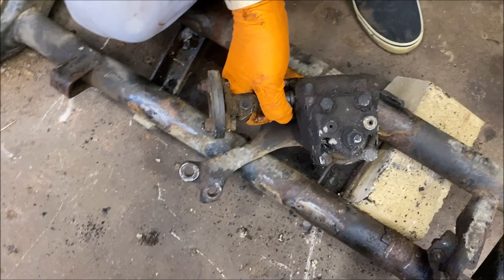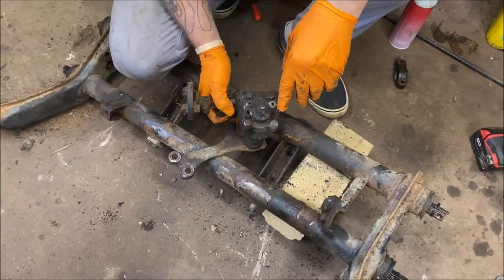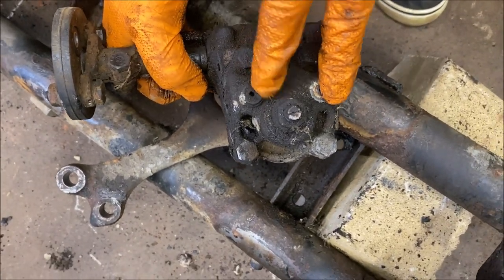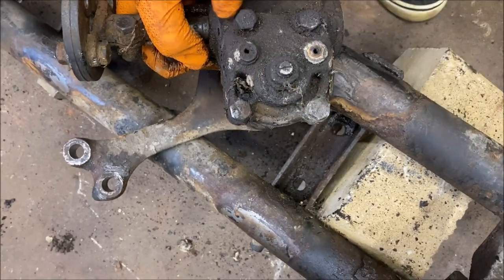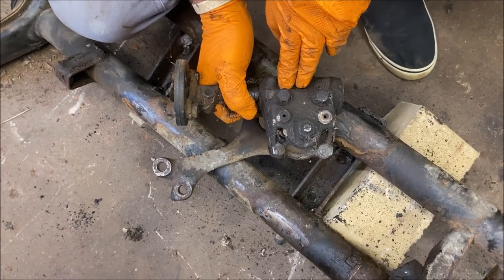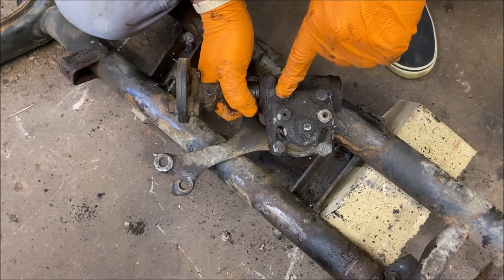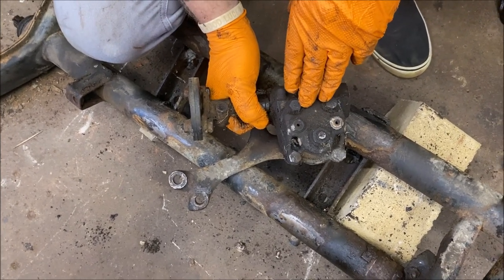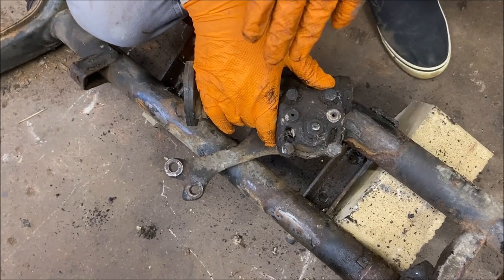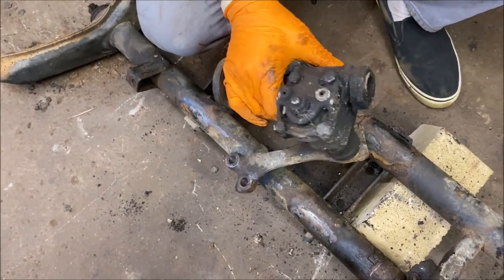Here is your steering box. We are going to do a nice cleaning and refurbishment — I did a video on this on a Super Beetle and we're going to do it again. Here are the plugs — we're going to pull those out because that's what you refill with. Four bolts. When we pull this off, there's a paper gasket. The paper gasket must be on there, not just for leaks but as a shim. These bolts must be properly torqued — I believe 18 pound. Because if not, your steering box adjustment won't be proper. We're going to use double-O grease because that's what I like in there, and that way you don't have leaks.